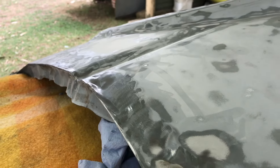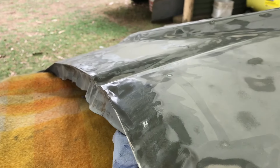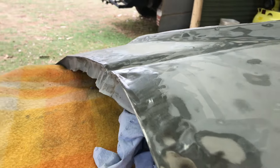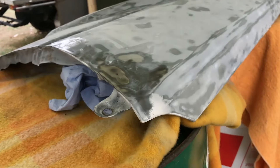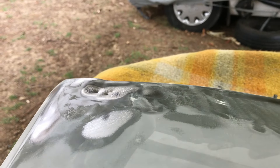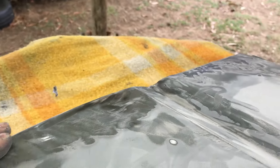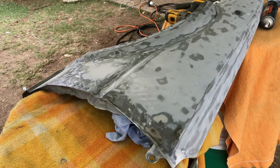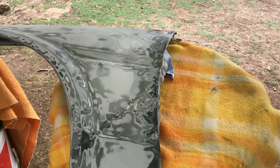I also pulled out a ton of filler out of this dent here — I'm glad I did because it still wasn't straight with the filler in it. I would have had to put more filler on top and probably would have ended up with six or seven mils of filler there. There's another one here you can see it in the light — it's not as bad as the other one but it definitely needs some bashing out. This panel is definitely by far the worst panel of the whole car. I tried my best to get a new one but there wasn't any around, so we're going to have to make do with this one.